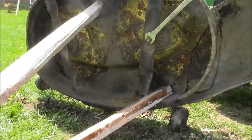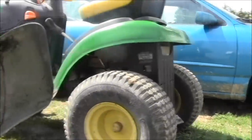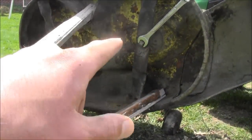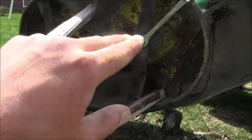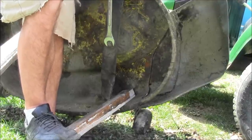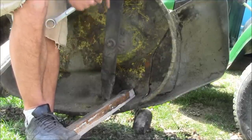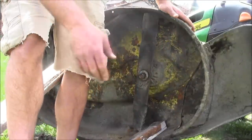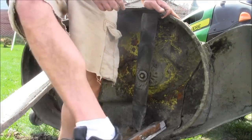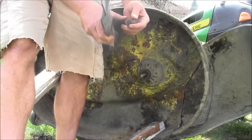I mostly work on the Ford Contour, but today it's the lawnmower. The block of wood on the bottom is holding the blade, because when I turn the one-inch wrench over the top it starts to turn. Watch out — this blade is sharp, so wear heavy gloves. There's the bolt; it's all rounded off. Up goes the blade — remember how it goes back on, because you've got to put it back on the way it was.